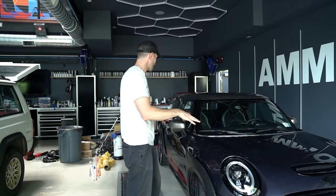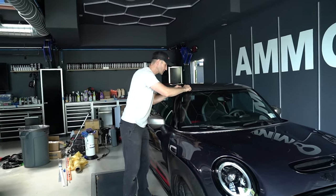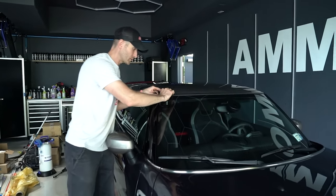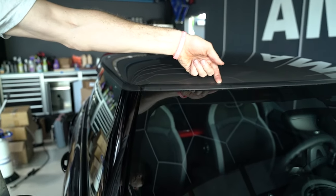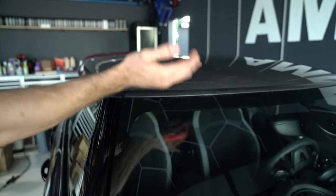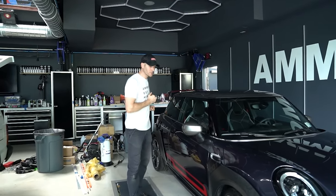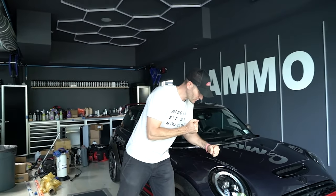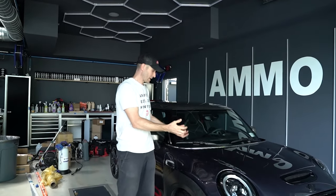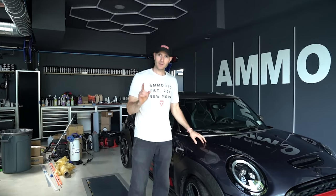The first thing is I wash it, and during the wash I look for all these little areas — specifically like this one here where the molding pops up. See how my finger can get under there? That means it's released — normal from everyday driving. We had to hit that with a power washer. Before a clear bra, I'm really getting into all the seams, because the worst thing is having something shake out while you're doing the installation.